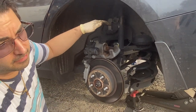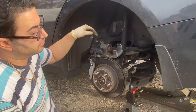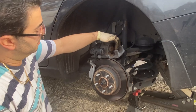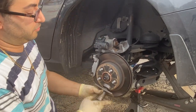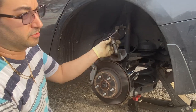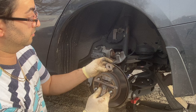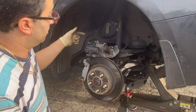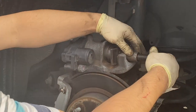For a 2019 Nissan Altima — or anything with an electronic parking brake module — you generally need a computer to release the motor and push the piston back. I'll show you a way to do it without a computer. Use a regular brake caliper tool or C-clamp, but not one with notches, because we're not twisting this at all — we're just pushing it straight back and manually moving the motor apparatus.